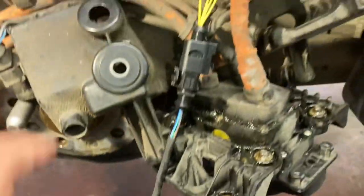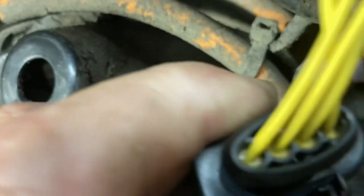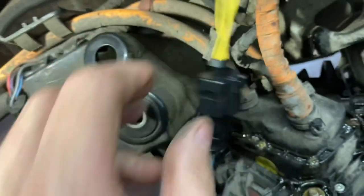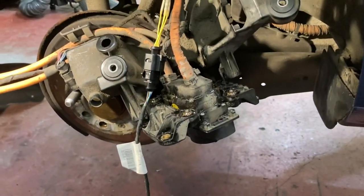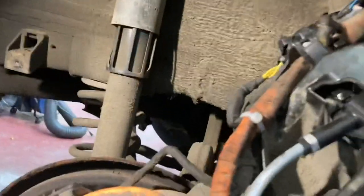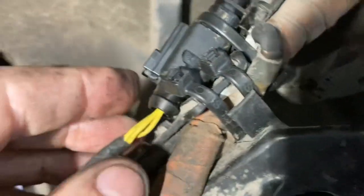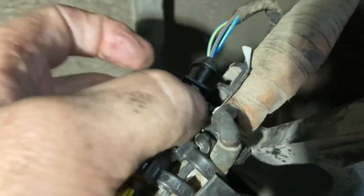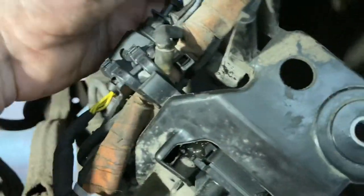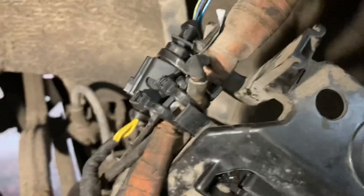I'm going to put the actuator back in its hole, tape it, install all the little seals to prevent corrosion, and spray some contact spray in the connector. On the next video I'll show the completed install. I have a tie wrap here for the wire, two here holding the plug on each side, another one holding the harness, and a white one holding the other side of the cable so it doesn't rattle. Everything is secured.